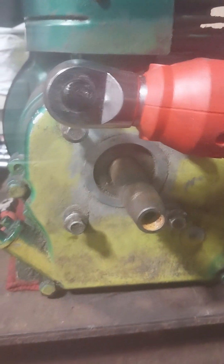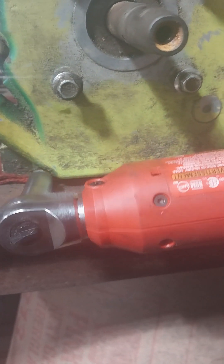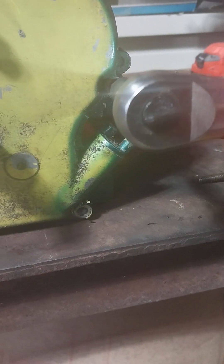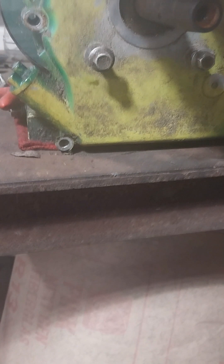They all run on starting fluid but that doesn't mean everything's always good. Did drain the oil best I could - always gonna drop one or two on the floor. Another thing is you want to make sure that all the bolts are the same length when you pull them out. It looks like they are. Okay, they're all out, let's pull this off.